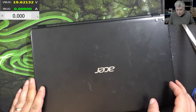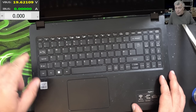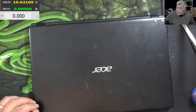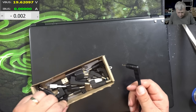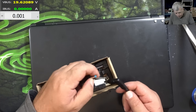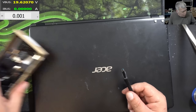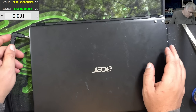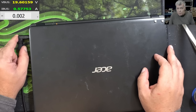This is a classic Acer, so most likely we can repair whatever is faulty. We have an Intel i3 CPU. Let's plug the charger — we need a blue Acer pin, which is this one. Plug in the charger and it's taking current. Check that — so it's not the charging port.